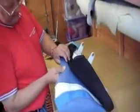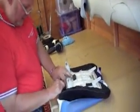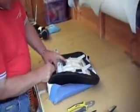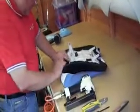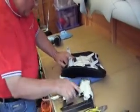Again, there's the centre, the felt tip pen mark we put. There's the centre of the cover. Again, pull that over. There's a little bit more than the original fabric there, but that's fine. Again, there's a nick in the fabric, so you can still see that that is central. You need to pull that across there. Give it a good pull to the front, quite tight.